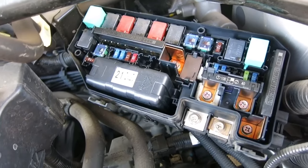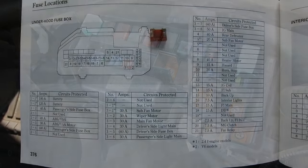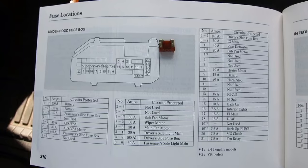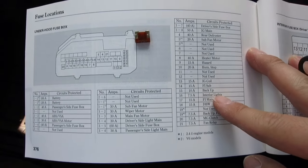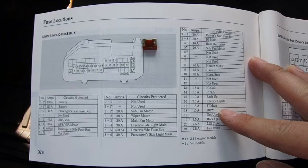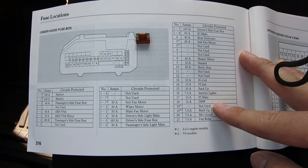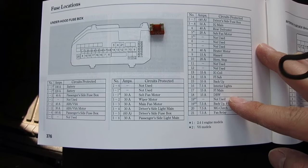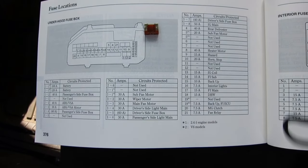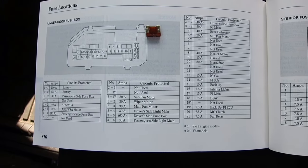Don't forget to replace the spare just in case you ever need it. Sometimes looking at the fuse box can really help when you're troubleshooting. If you're upgrading your light bulbs or dome light and none of the interior lights turn on — like I experienced — it may be your fuse, so hope isn't lost. Go ahead and replace the light bulbs with known good ones first.